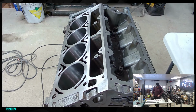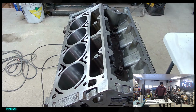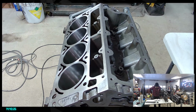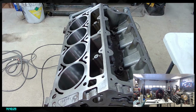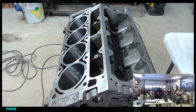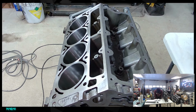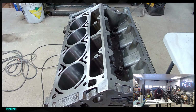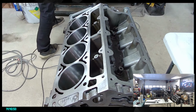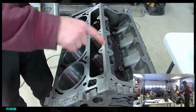Let me check what they are doing next. So basically the next step will be to clean all the passages on the other side for the crankshaft, and then we're gonna have to clean up the crankshaft. So, clean the other block passages. We're gonna have to clean with mineral spirits all the bearing surfaces and stuff. Like I said, the air, we just did that. Cylinder wall, again, mineral spirits, because did you know that you cannot use the degreaser for any engine component on the inside? It makes sense, but basically that is a no-go on the inside.